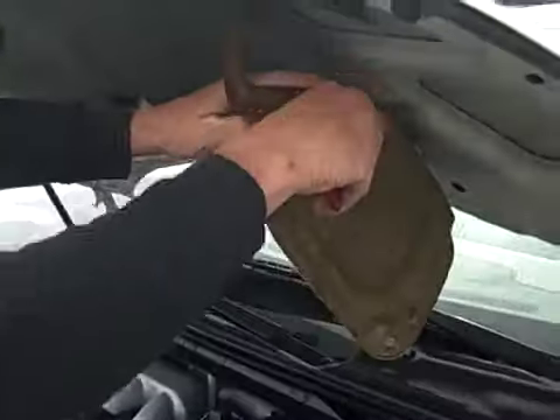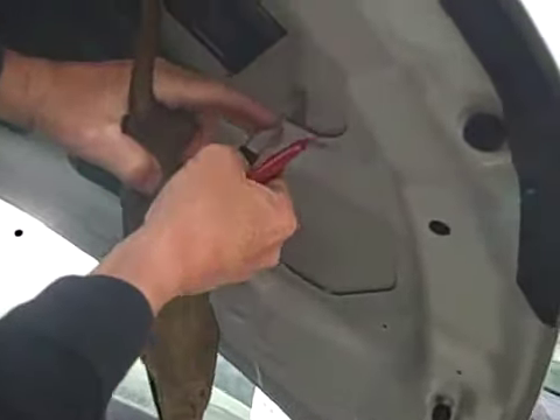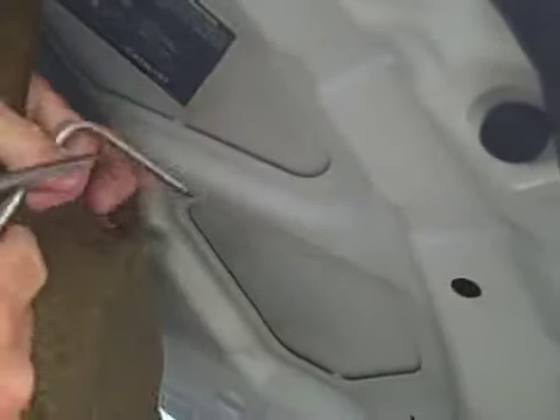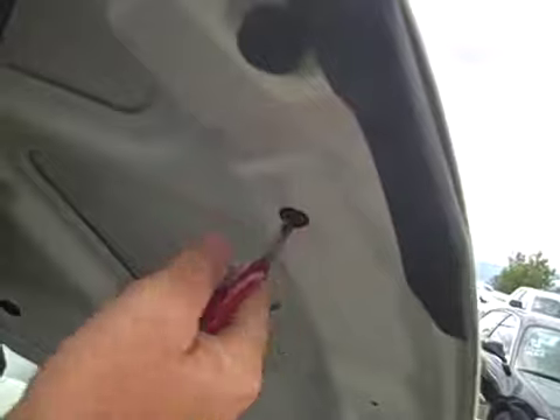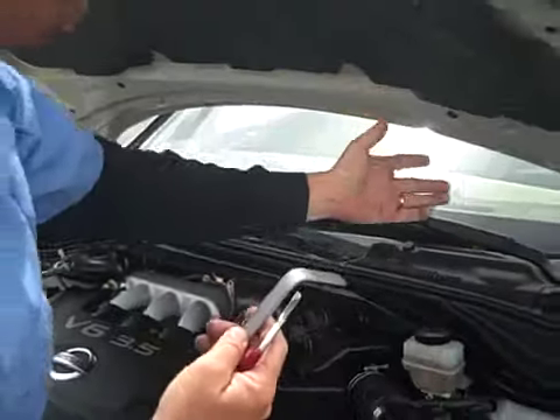If you look under the hood here, you're going to see there's a cross brace like you'll also see in trunks and roofs. You can either use one of your Z-bar tools for sliding in under the brace and either twisting or pulling back up to get leverage to push it down out, or you can use a smaller hand tool to get the same action. We'll also use these tools for fitting through holes sometimes to get into dents. A lot of times the plugs will come out and give us more access. These tools are great for hoods, trunks, or roofs.